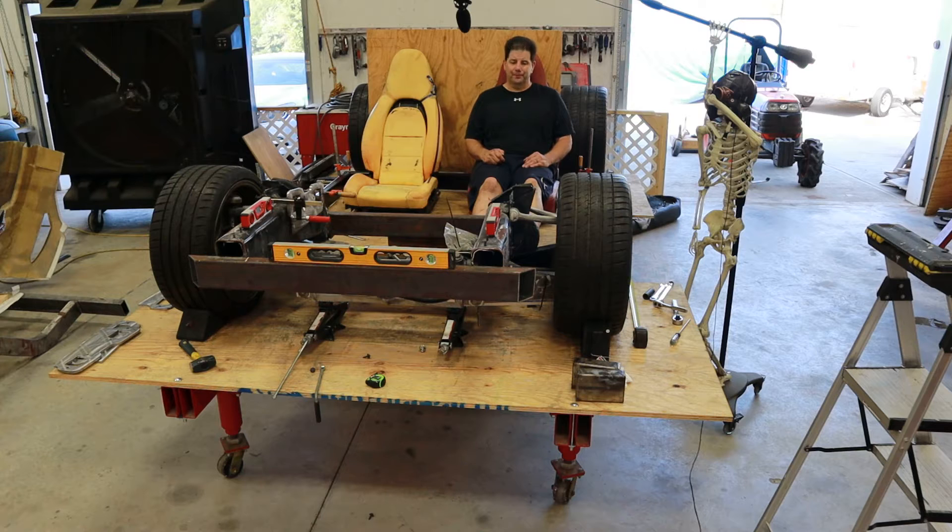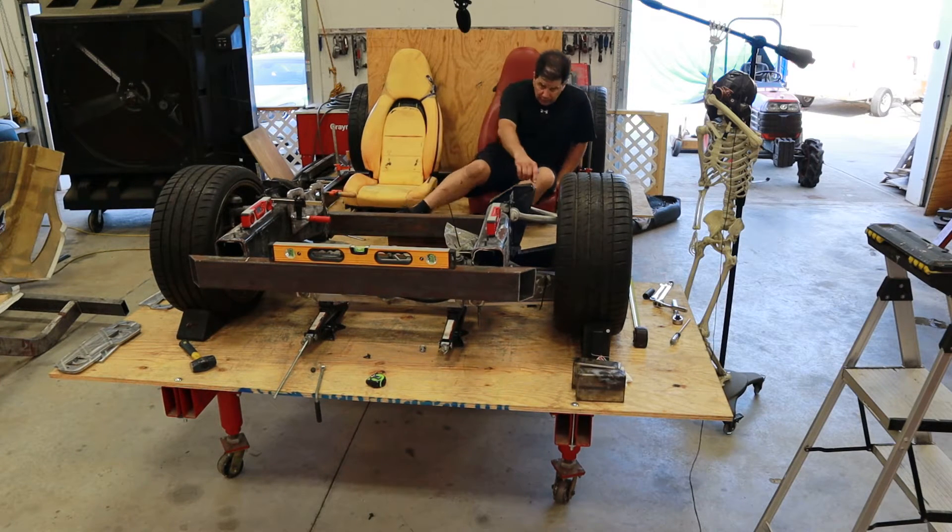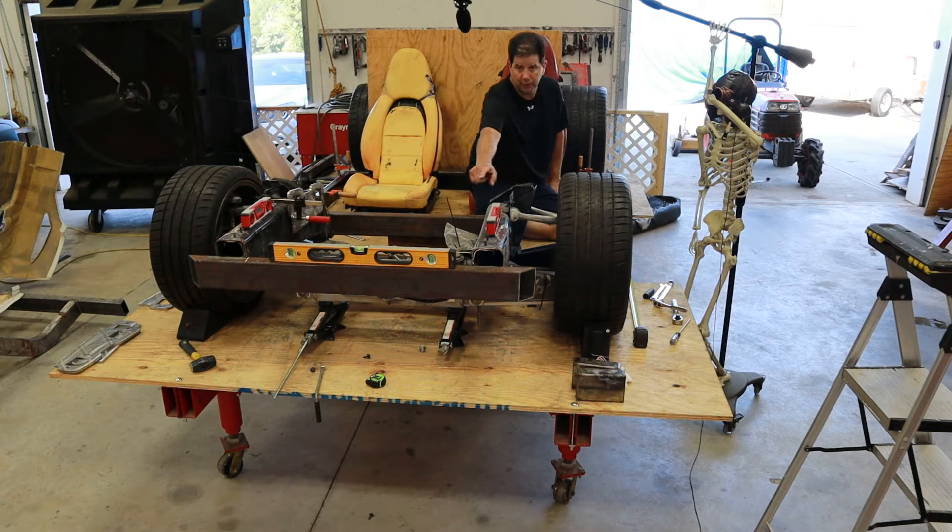Now it's time to fix the front end. It may look like it's attached, but it actually isn't — I cut it off in the last video because I needed a little bit more legroom. We've got the car at 107.7 inches, almost 108 inches, so it's about an inch longer than the C8 Corvette and a little bit longer than a Lamborghini Aventador. What I originally wanted to do was try to salvage the C6 front cradle here, but it's really pretty ugly and I'm also not going to be able to use these shock positions anyway because I want to run a cantilever suspension, so I'd have to cut all this out as well.